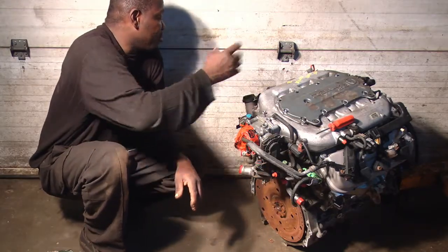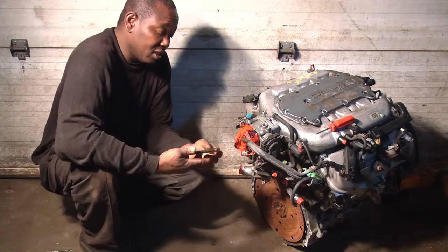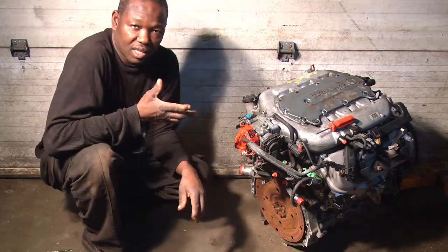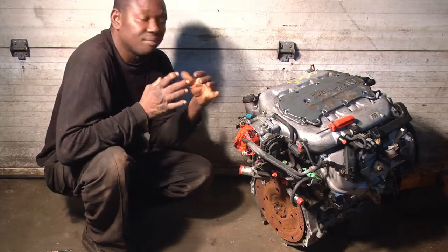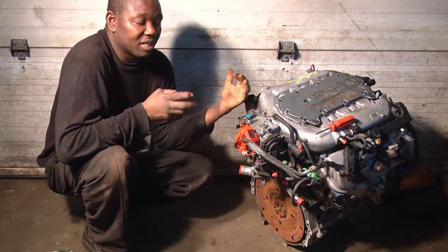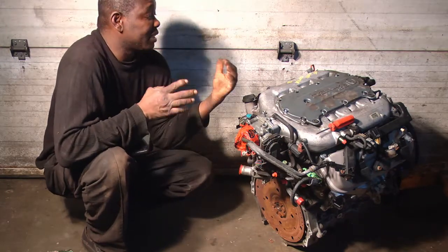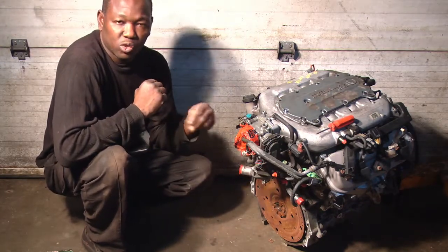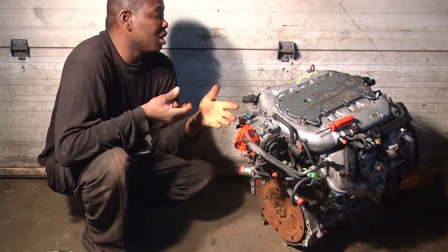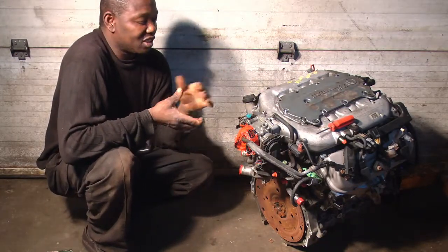Remove everything, check the spark plugs, and when I change an engine I always check the timing belt. Open the timing cover and inspect the belt — if it looks fairly new I'll use the engine as-is. But if the belt is cracked or too loose, I'll replace it, because I don't want to finish the job and then two months later the belt breaks and the customer ends up needing another engine.